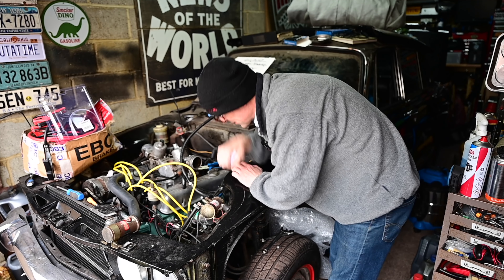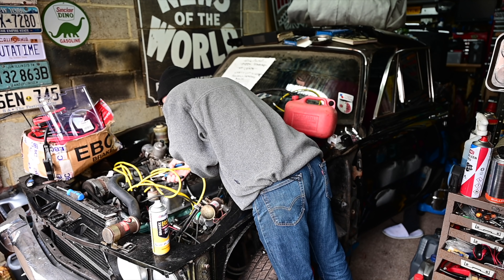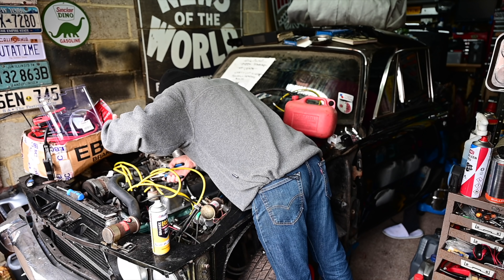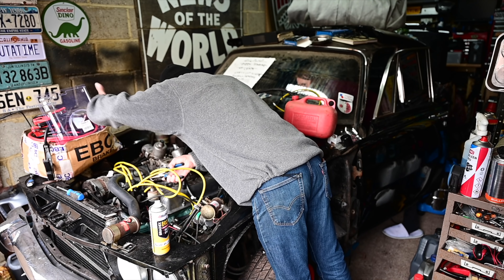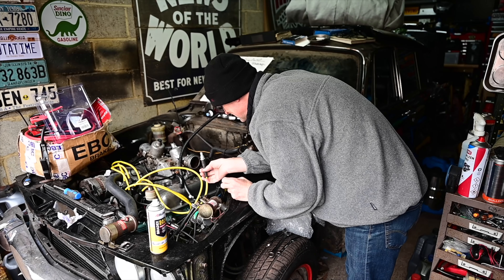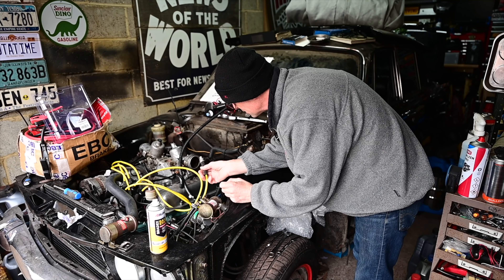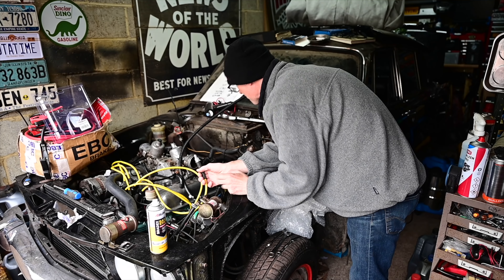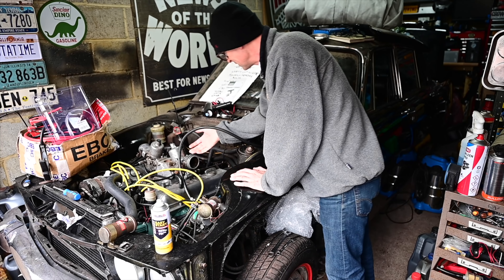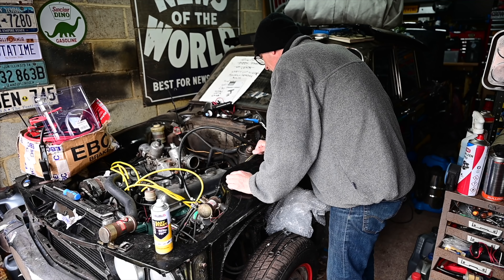I'm more confused than I was before. There is petrol in there, there's petrol at the carburettors - why is it not reaching the cylinders? With the help of an assistant there is a spark - it's not the strongest spark in the world but it is a spark nonetheless. It's fuel delivery, that's all it can be. I need to go back to the drawing board and work out why fuel is not getting through. The carburettors are all clear and cleaned - we rebuilt them not long ago. I literally don't get it.